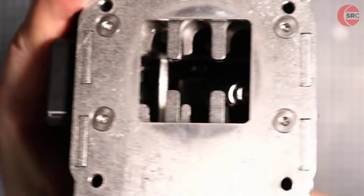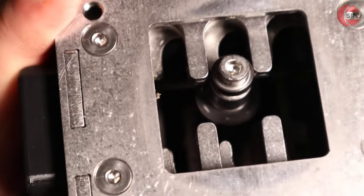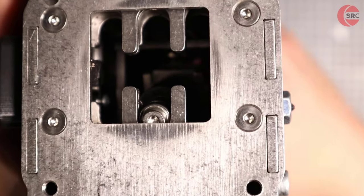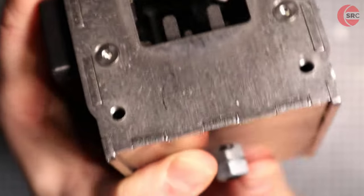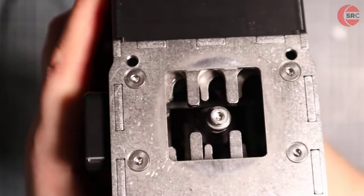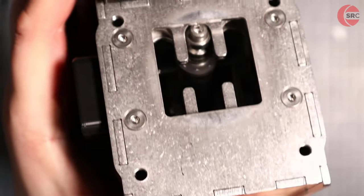The smaller gate is a moving part controlled by a connected motor. And we can see this working. The active lockout is releasing and the gear stick is now able to fully locate into the channel. And when the gear stick is pulled out of the gear into the neutral position, the lockout gate resets.